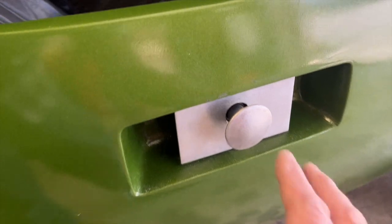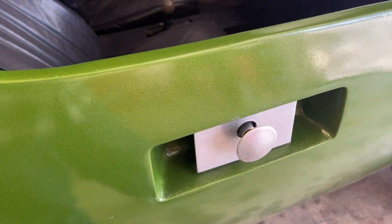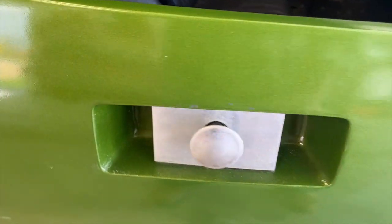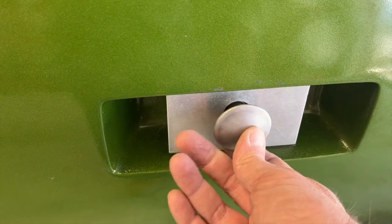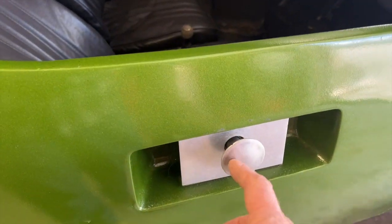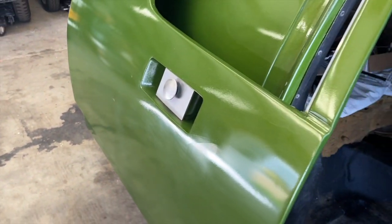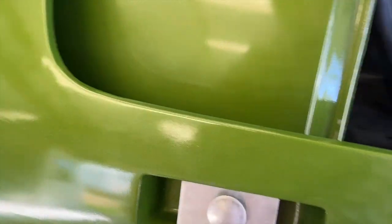We were missing part of the knob here. Originally the little button that's in here had an insert and a key that was from an early Datsun Z, and apparently those parts are pretty hard to find. So rather than deal with that, I wanted to figure out something that might be kind of fun, kind of period, and kind of cool looking. Ben fabbed up a rod that went through there into a handle on the inside. This little disc was a leftover from the Mercedes project when we were trying to replace some missing pieces for the top irons. He put a rod on that goes to the inside. So you simply push on the button, the door releases, and then it slides open. What I love about it is it's got a real modern look to it, certainly in keeping with the period of what the car is all about. Unfortunately, it's not lockable, but we can play around with that if we need to.